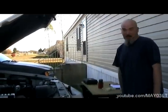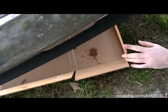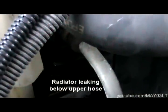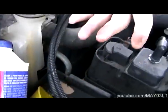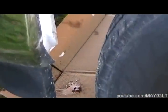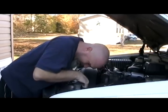We've been letting it run for about 15 minutes and we definitely got something leaking — it's up front, right here. It's the same color as the coolant. Going around this upper radiator hose, the bottom of it is pretty dry, so I'm going to shut it off. Yeah — see, it's kind of snotty, and it smells like that Dex Cool. It almost looks like the seam right here is split somewhere.